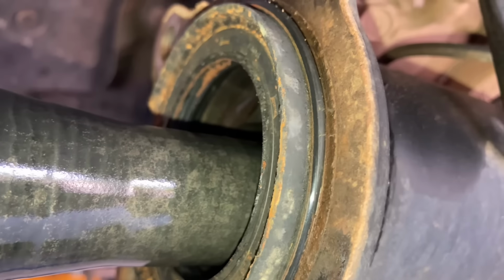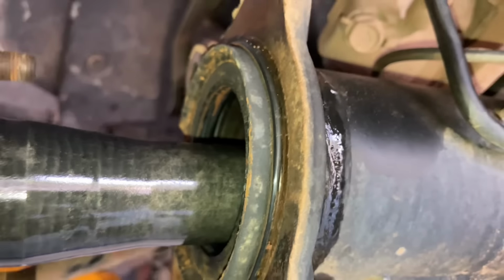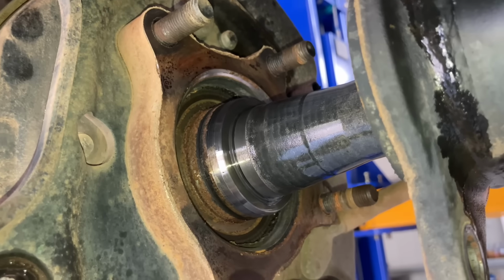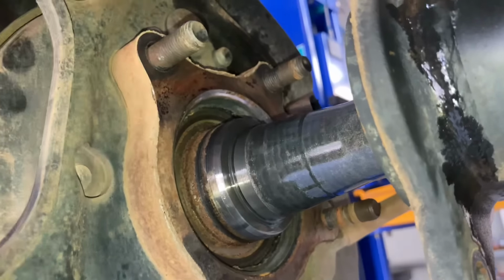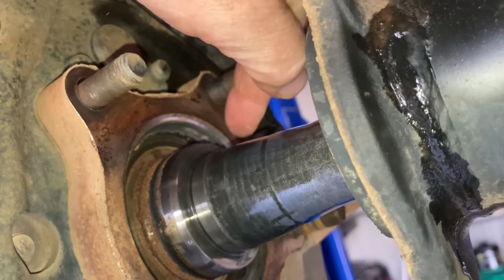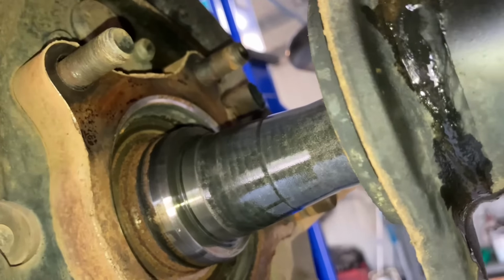Like I said, I'll work out more accurately how many Ks they've done. But now that we know there's some water getting in there, I'll spray a little bit of stuff to clean it out. And I'll redo that ABS sensor and put a bit of RTV down the hole, because I believe that's where the water might be coming in. I'll have a closer look at that.